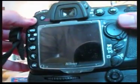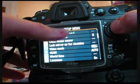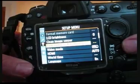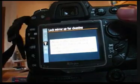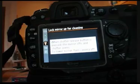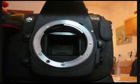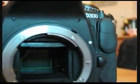On the back of the camera, turn it on and go into the menu settings, and then in the setup menu you have one saying mirror lockup for cleaning. Just press OK. When you press start, it gives you a little warning notice saying when the shutter release button is pressed, the mirror lifts and the shutter opens. To lower the mirror, turn off the camera. So if we look at the inside of the camera when we do this, that's open, and that's you seeing into the camera. That's the sensor in there.